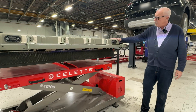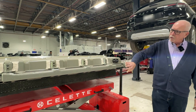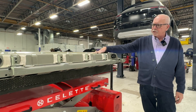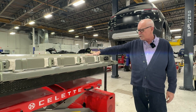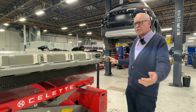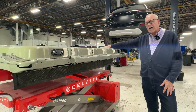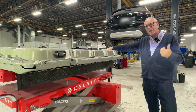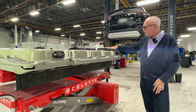Looking at the battery case on this vehicle, we can see it looks similar to a Tesla battery — there are big outer reinforcements and structure to hold it. The top case is different: unlike a Tesla where there's a single layer case with access from the top, this has a sort of penthouse-looking component. GM uses more of the pouch style cell versus the cylindrical cell, but it's similar in shape and size to a Tesla battery, although this one's a little bit shorter.